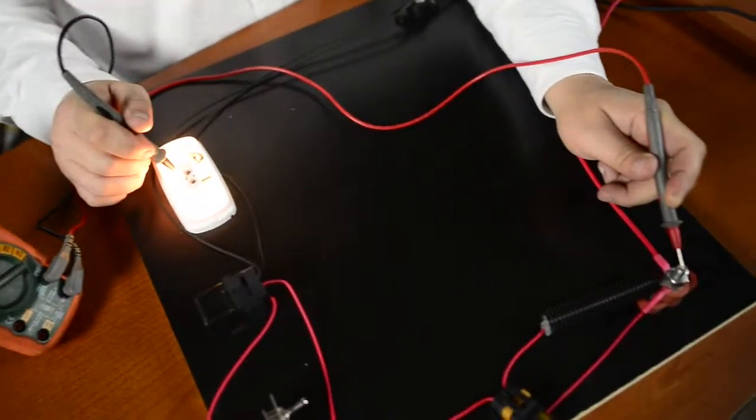This is the same type of circuit you have for a starter or alternator. If we have corrosion on our big cables, you're not going to get the right voltage to that starter for it to work properly. Keep in mind that a starter has to be tested under load. It's always very important that you go back through when you are done and recheck it to verify that was the issue and that you were able to fix it.